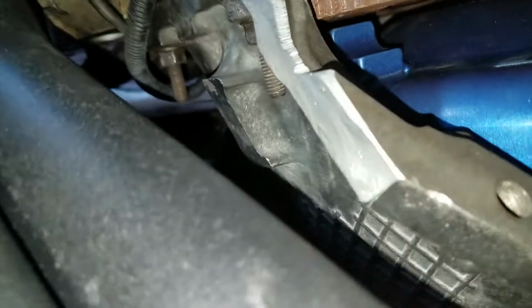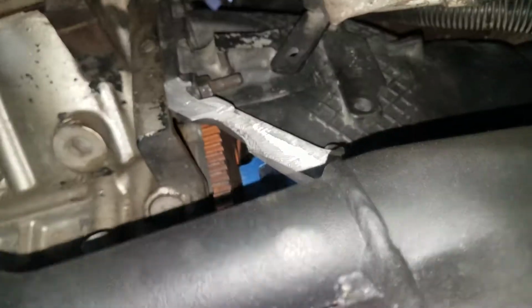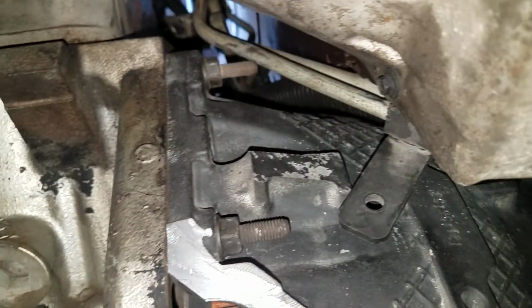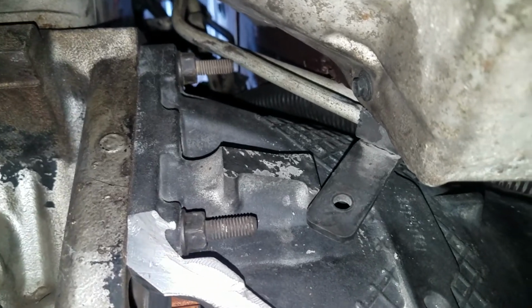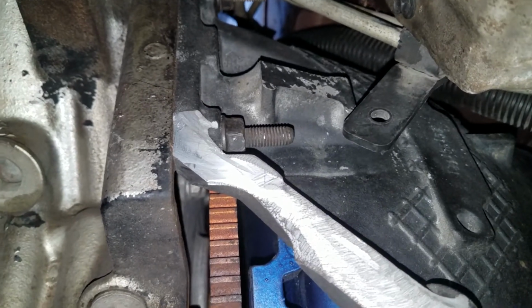There's one there, and then there's the other one up there. I did that with the wrench. Easy money right there. If you can get your hands on a 4L80, go ahead and do the install, man. Quit messing around. Look at the space. Look at that right here. Bam. Bell housing bolts. Boom, boom. I tightened those up with the 14mm with the wrench. A little bit tighter than snug.